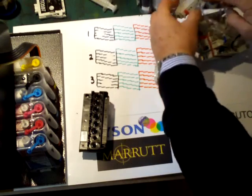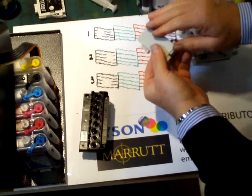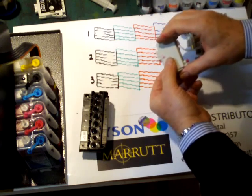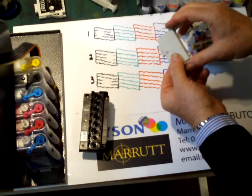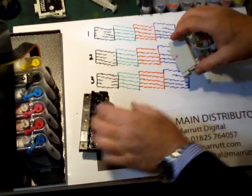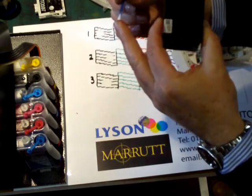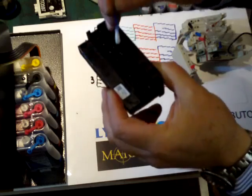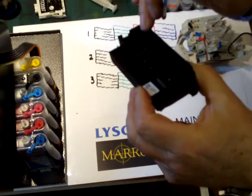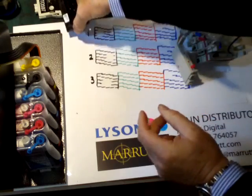If it's the case of a CIS system where the cartridge itself is failing, you can simply order a new CIS cartridge of the correct color. See our training video clip number 9, 'CIS Cartridge Change and Maintenance'. This video shows you how to change and reprime the CIS cartridge and how to clean the little black plastic spigots which pierce the cartridge. We soak a cotton bud in hot water and clean around these spigots to ensure a nice clean airtight seal between the piercing spigot and the cartridge — that's what really makes the difference in printer reliability.